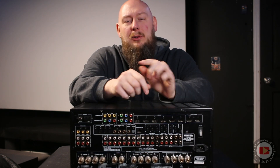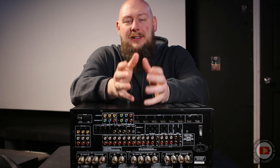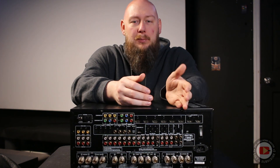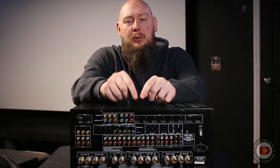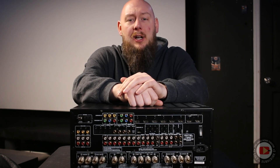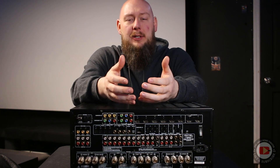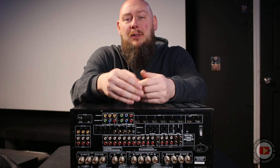What is multi-channel input? It's kind of what it sounds like. It was initially made for fixed line level inputs from disc-based media — like super audio CD players, DVD players, and even Blu-ray players — which had multi-channel output that you could connect to the multi-channel input on a dedicated AV receiver. Not necessarily as a power amplifier, but to give you multi-channel surround at a fixed level input for disc-based players. But you can tweak this and use it as a power amplifier.